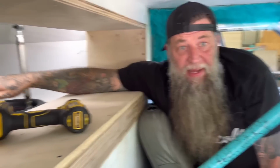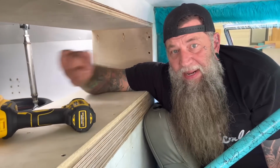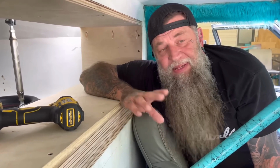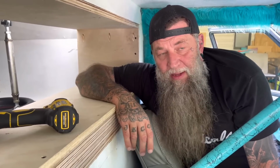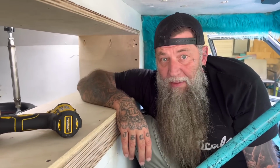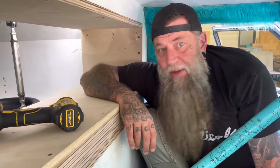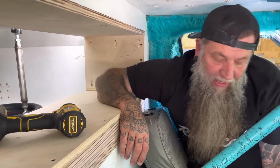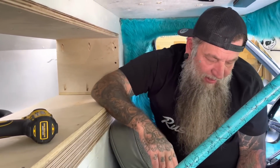When we put motors in, I didn't have enough wire. We needed to make one wire. Dustin had some 8-gauge OFC red, and that was great. We made one wire that was black and red. When he hooked that sub up, he put red on positive. So it put one sub out of phase. I found it this morning.